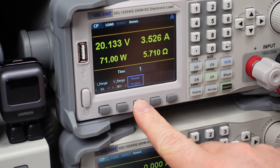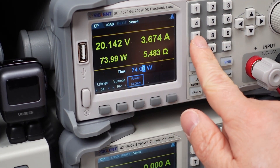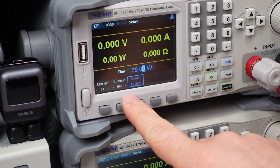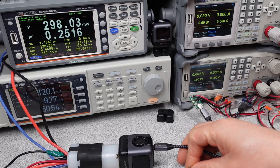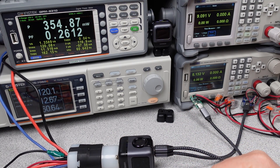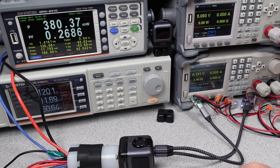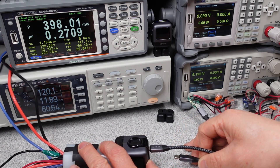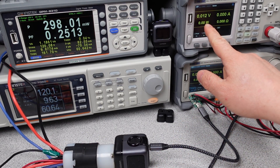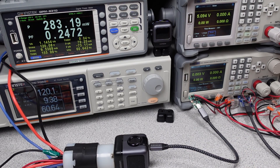Overload testing checks when a device safely shuts down when too much power is being drawn, like in a short circuit or fault condition. This power adapter shut down at 75 watts, which is a safe limit, and it recovers after removal of the fault. Since it has multiple ports, I can check power delivery renegotiation between ports — each plug and unplug triggers a reset, and it is actually quite a bit slower than I've seen from newer adapters, which can interrupt charging and be a bit annoying.